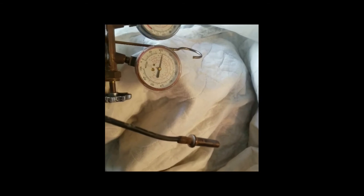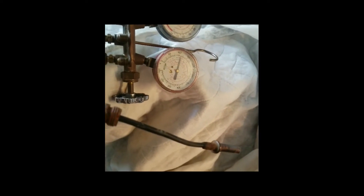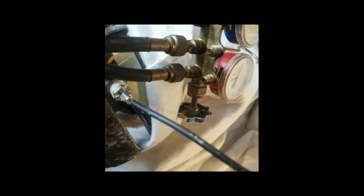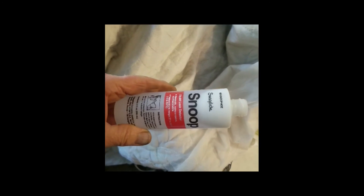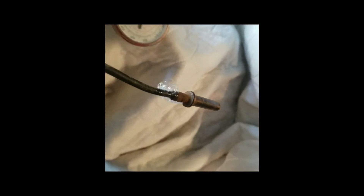I have found the leak after putting over 100 psi on the system and hooking it up to this Swagelok adapter on the cap tube. If you take a little bit of this Snoop, which is sold by Swagelok, and watch — a little bit of Snoop right here — you can see the bubbles form right there.